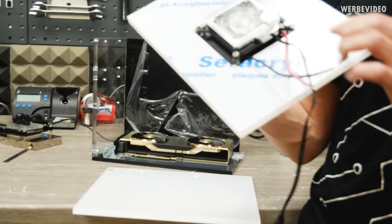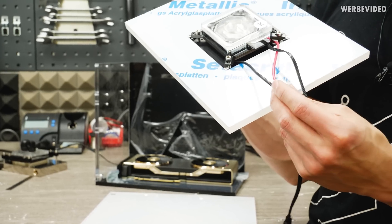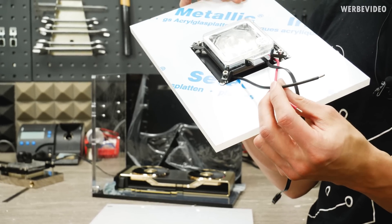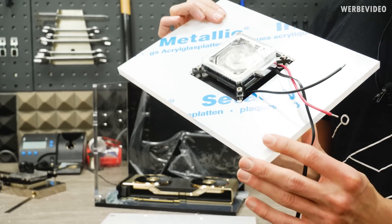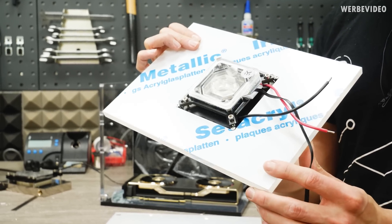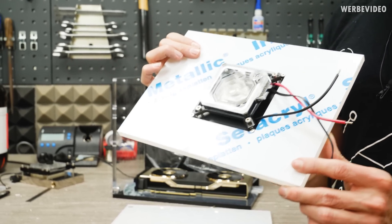This is a 300 to 350 watt TEC element, so it has a very high power consumption. It's quite tough to cool those elements as well, but it's necessary — the rule of thumb for TECs is that you always have to have double the power consumption of what you want to cool.